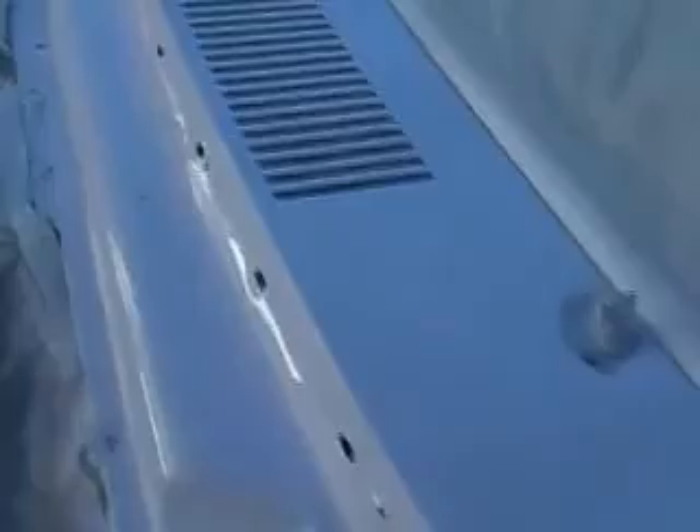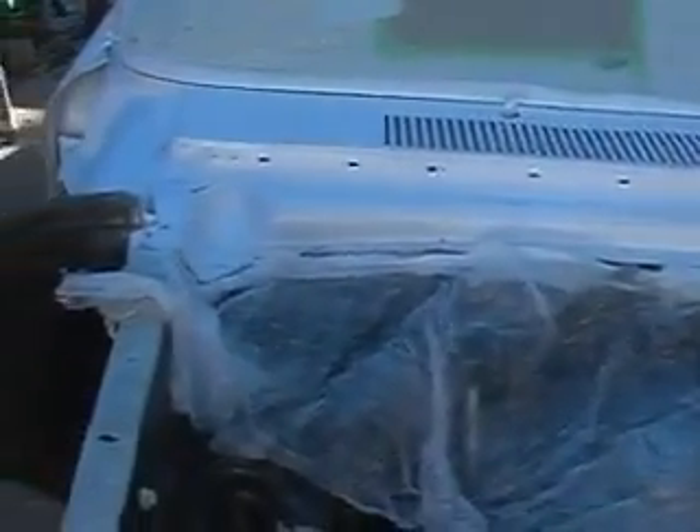It's covering good — it covers scratches. A lot of this I just sanded with 80 grit and it's coming out flawless. Worked around the door here, went up my window trim here. The paint's laying down pretty good. We'll just let this tack up a bit and put another coat on it — for a full first coat it looks really nice. Pretty forgiving paint.